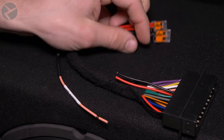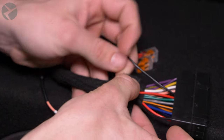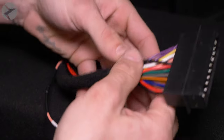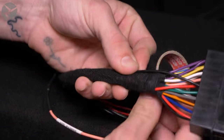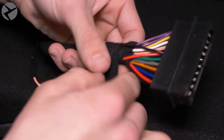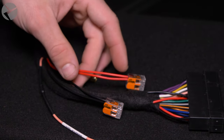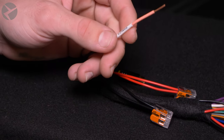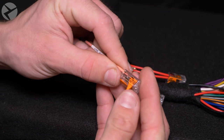To clean up the installation and avoid any shorting, separate and tape the other ends of the black and red wires to the harness. To keep everything clean and safe, pull the end of the pink insulation off as well and place that into the last WAGO connector. Even though we won't use it for this, it still keeps everything secure.